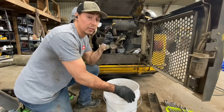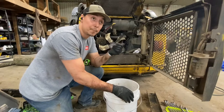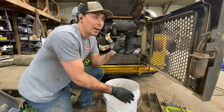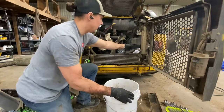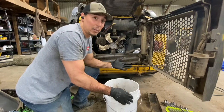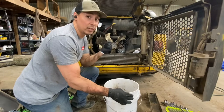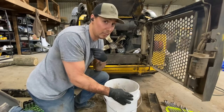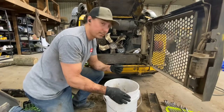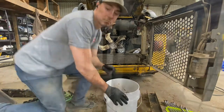I have to pull the cab because there's just not enough room to get in there and see what's going on. There was only one video I could find close to this model for popping the cab — it's actually really easy. However, I have the radiator pulled out, I've got rags in the hoses, and I have to start it to get the boom up. Probably not the greatest idea, but we're going to fire it up, get the boom up, and show you how to pop the cab. This is my first time, and if it's your first time, we can fail together.